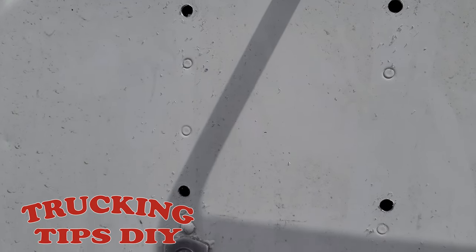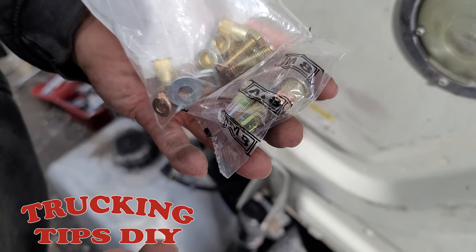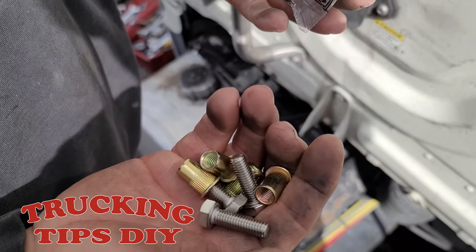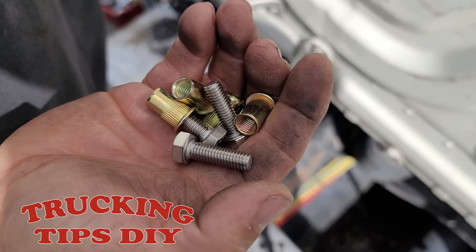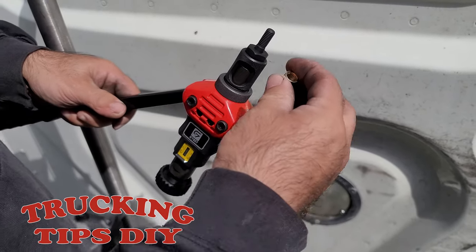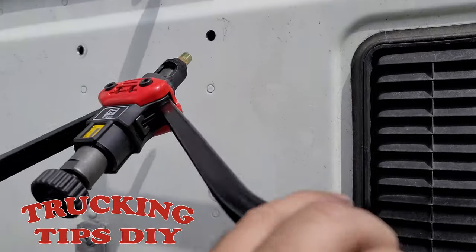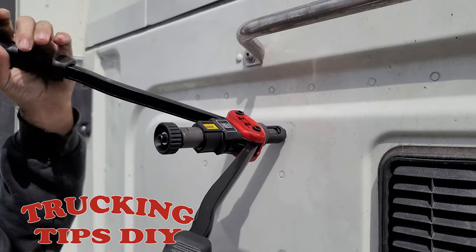The four holes are ready. Now we're going to go ahead and insert the rivets. I'm going to be using my own rivets — this is the 8 millimeter. I'm not going to be using the ones in the kit because I want to use stainless steel bolts. We're going to insert the rivets using this tool — I'll try to leave the link in the description for anyone who wants to buy one. You just insert the rivet nut into the hole and close the handles.